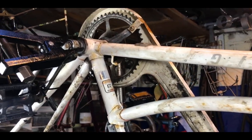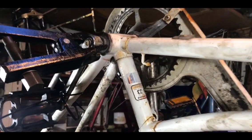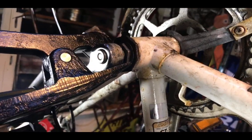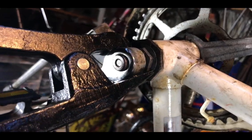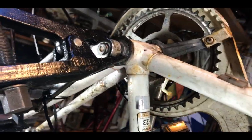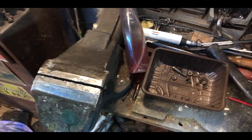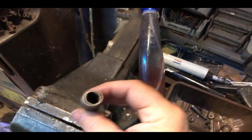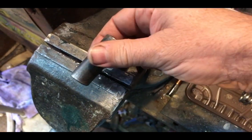After years of having hockey stick chain guards fastened by a bracket - which was perfectly serviceable for decades - they went over to this continental style wraparound, which I suppose they could tout as an improvement, but it wasn't. So if this hadn't come out, what was next? Next was to apply some heat. I don't have an oxy-acetylene torch - I really should have at least an acetylene blowtorch. What I was going to do was strip the remains of the frame off and carry it into the kitchen, put it over the gas hob until everything reached cherry red, and then give it a good whack or apply the tool again. After that it would have been laying the frame in the vice with a socket covering the end of the pin and squeezing it out in the vice.